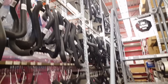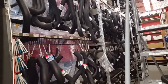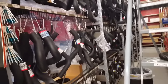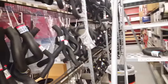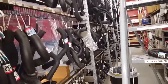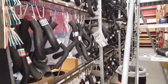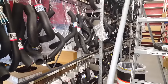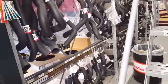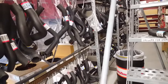Here I am at the Walmart of radiator hoses, and I need to find a hose for my radiator. It's got a one-inch inlet outlet, which is a joke — I wish they would have gone one and a quarter. However, OEM is one inch. The top hose on anything newer than '67, '68 is one and a quarter. So I got an outlet for the thermostat that's one and a quarter, which fit great with that Honda radiator I had. The lower hose I have a reducer for. So I'm going to need some sort of reducer or enlarger, or just stretch the hose on the top.